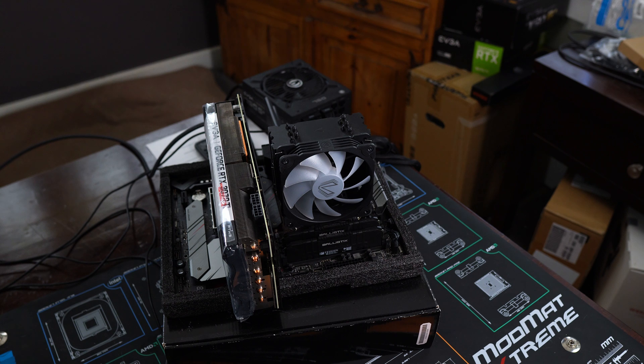If you didn't remove the plastic film, it might work but your CPU will have irregularly high temperatures and it's going to cause problems under load. Remove your CPU cooler, check for the plastic film, make sure you have thermal paste applied. If that's not it, remove the CPU, check for bent pins, check if it was seated fully, then reseat it and try turning on the system.